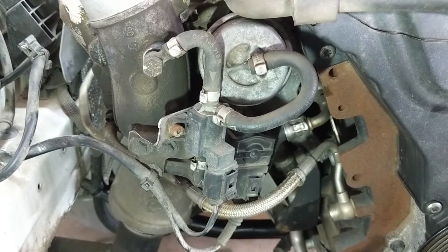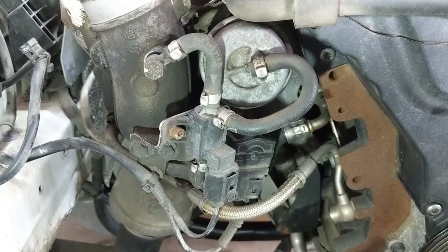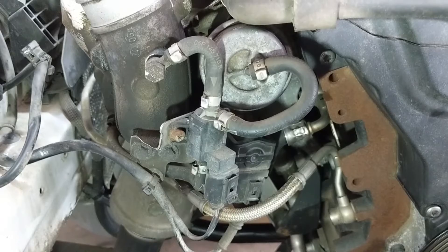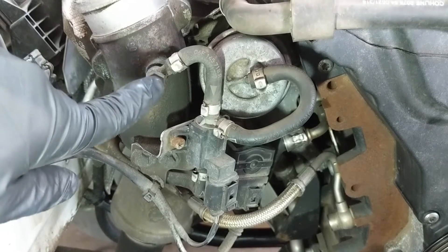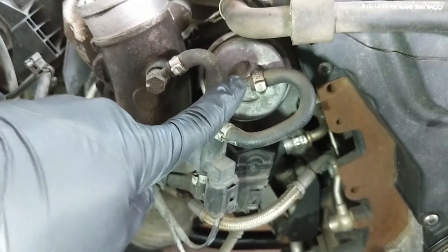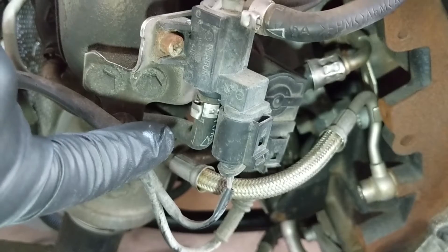Here's the configuration of the N75 valve. Although the stem orientation might differ a little bit depending on which Audi or VW you're working on, you're basically working with three lines. One line is the ambient air pressure and the air return line into the turbo intake track. One is the air pressure line into the wastegate actuator. And one is the boost pressure feed line coming into the N75, coming from the compressor side of the turbo.